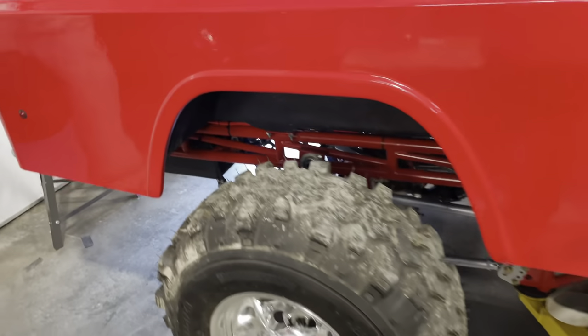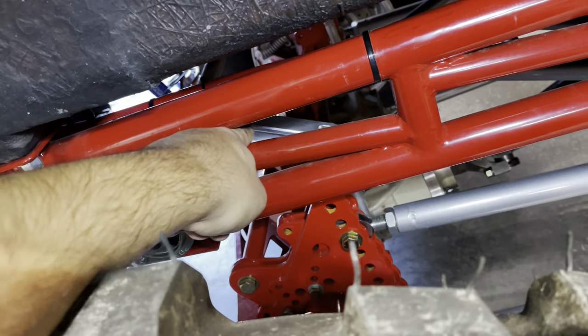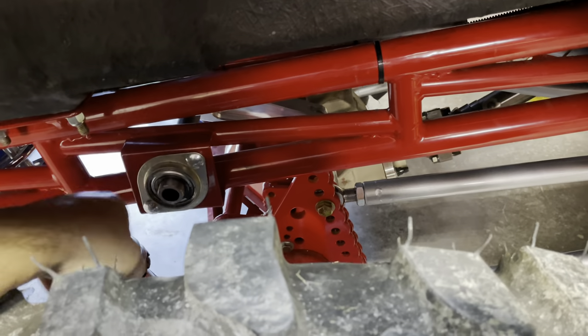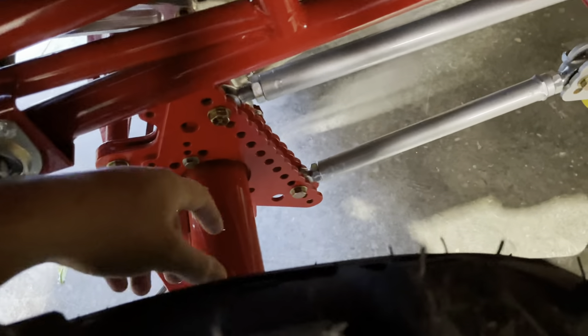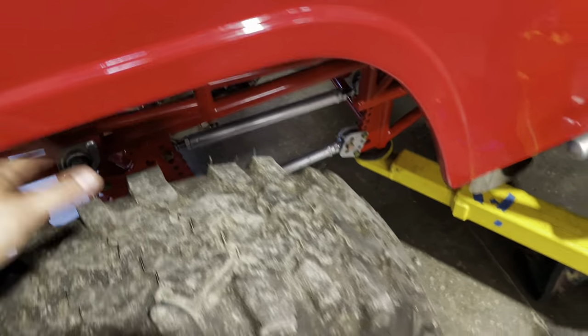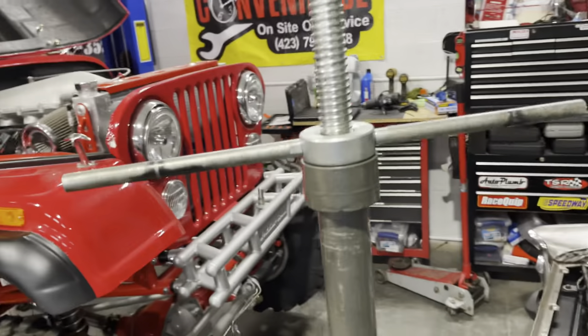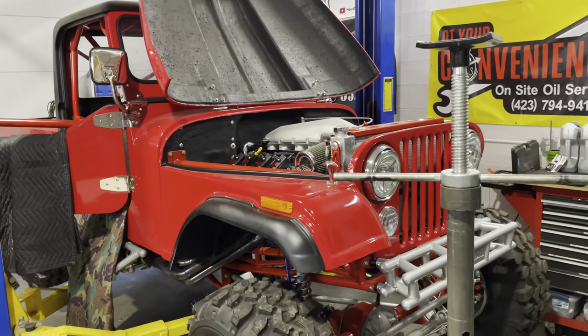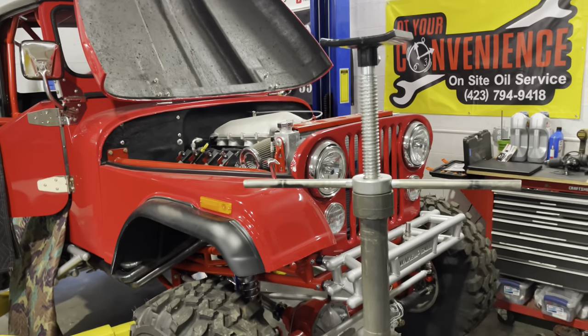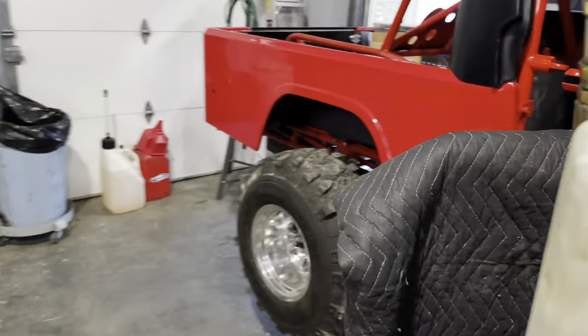To give the most amount of space, these aluminum billet anti-roll arms — I'm pointing at that little arm — used to be mounted out here. I cut all that off, moved the mounts inboard, so now they can fit a very wide selection of tires and rims. That's a lot of updates and fixes. This took a lot of time; very minute detail things that were really complex, but they're done. The Jeep is done.